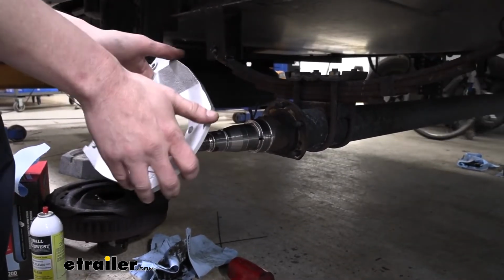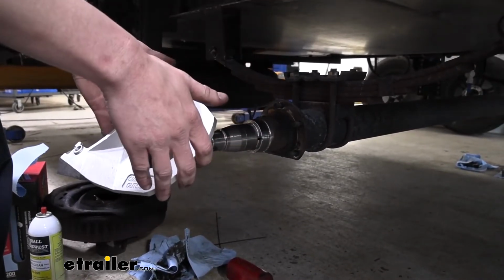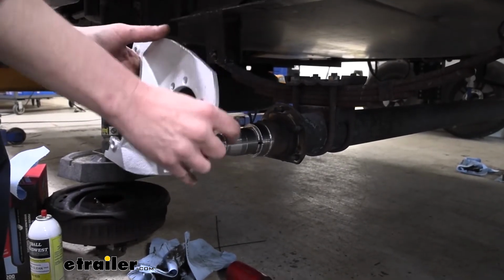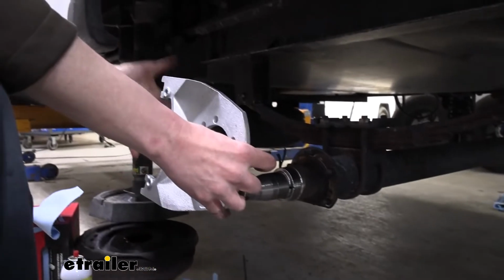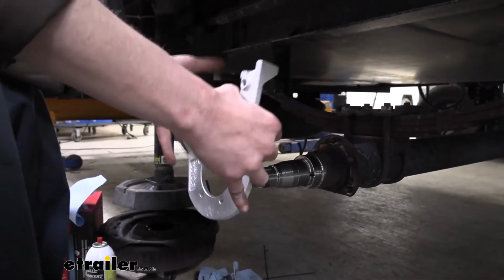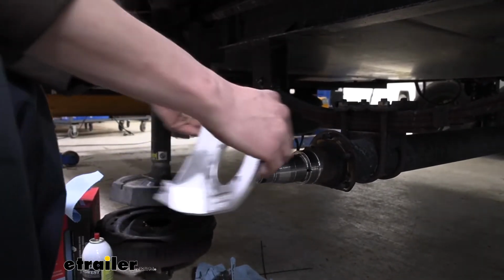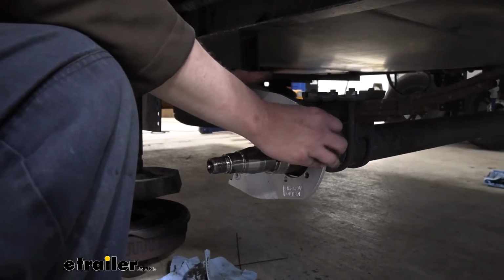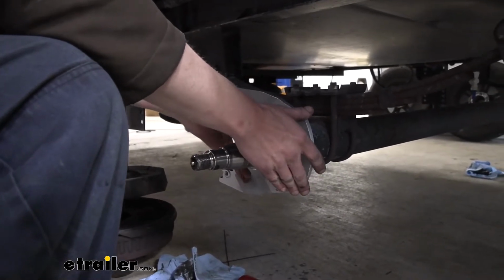Ours is gonna fall under the 8,000 pound category. So we're gonna put ours facing the rear. Our caliper mount needs to face the rear of our trailer. The ones that were heavier would sit on top like that, but ours is the lighter. So it's gonna go in this orientation here. That'll just slide right on your hub there,